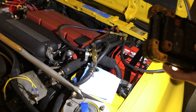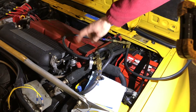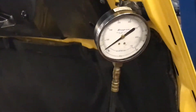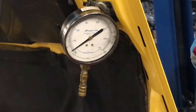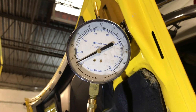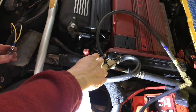What we're going to do now is run our fuel pump, then cut fuel pressure at the ball valve — that'll leave us with just pressure on the gauge side. We're going to cut our fuel pump right away so we don't back it up, damage it, or overheat it. We'll get a reading on our gauge and it should be somewhere in our 4.5 to 7 bar range. I'm expecting to probably hit close to the 100 PSI side of things, and that'll tell us if our fuel pump is healthy and strong. You only do this for a couple of seconds. So I'm going to run the fuel pump first — just going through the system — then cut fuel off from the rail itself, and that'll back everything up at the gauge.